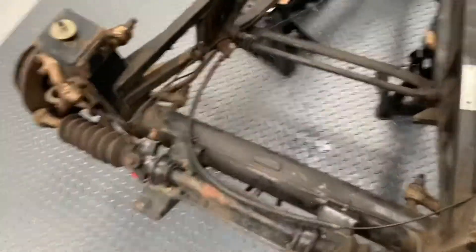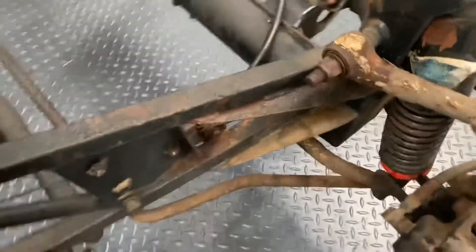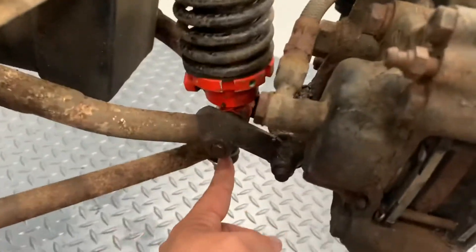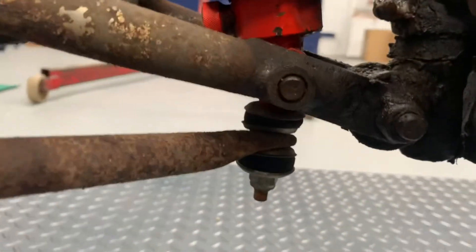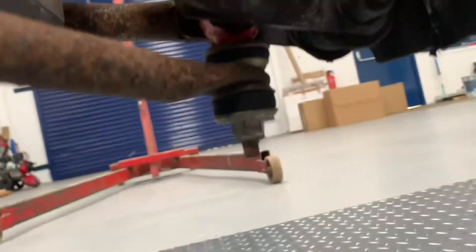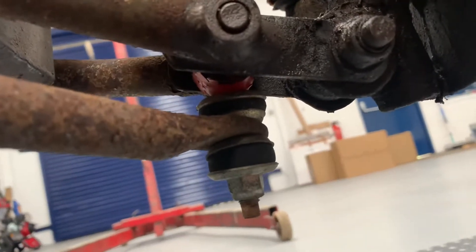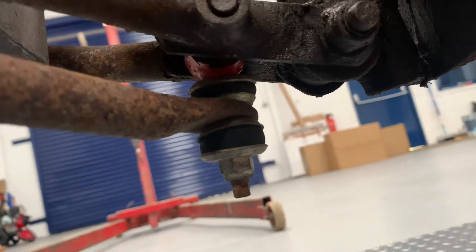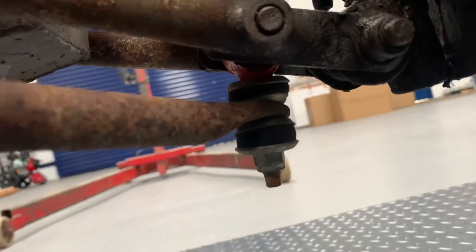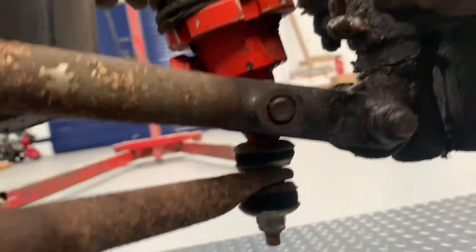The car did have a front anti-roll bar. The front anti-roll bar is a little spindly effort here, connecting on to the bottom of the lower arm there. And if you follow the manual, that's actually your jacking point for the car. If you need to jack a corner up on the suspension, that's where you're meant to do it according to the manual.